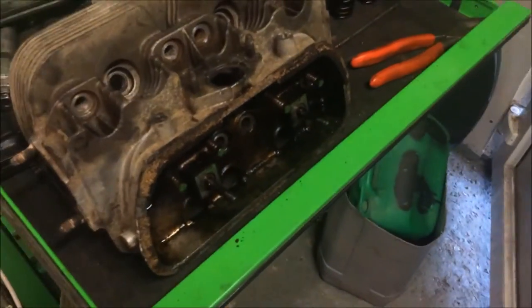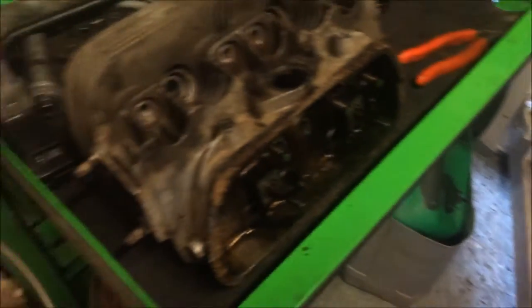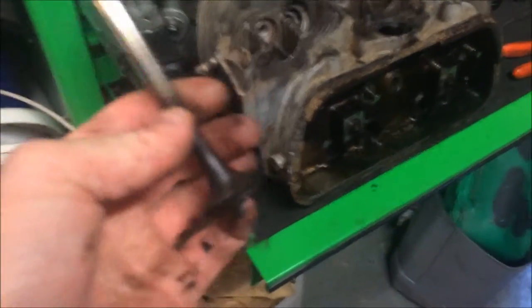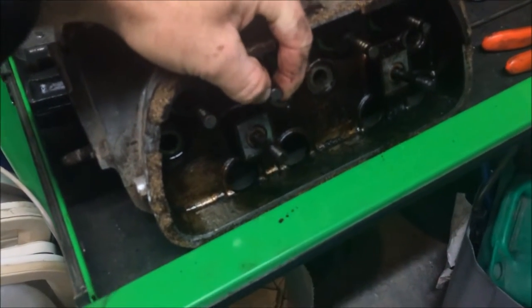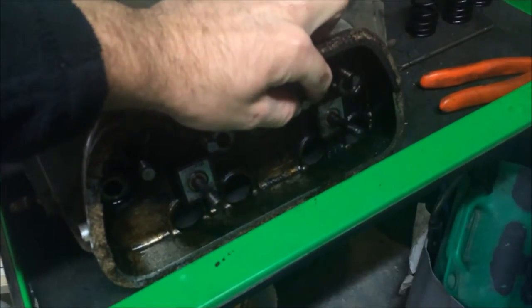There's the head with a bit of a head gasket still on it. I took all the valves out - the problem with exhaust valves is them breaking and dropping. They had a white powdery color on them and I've ordered new exhaust valves, but I might also need new guides in this head. Let me put a valve back in the head to show you. On the inlet valves I'm getting no movement or just ever so slight, and the same on that one - just a little bit. But on the exhaust ones...